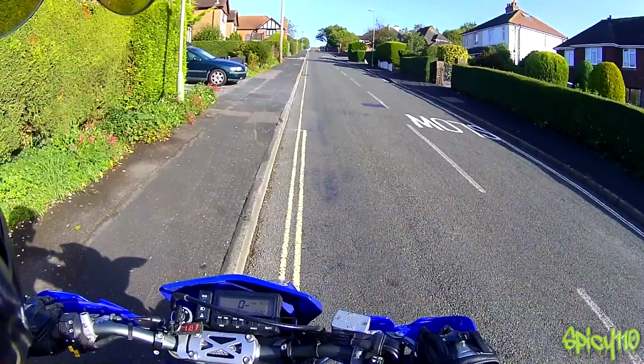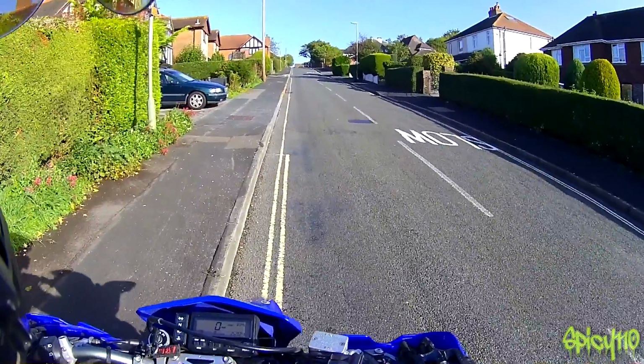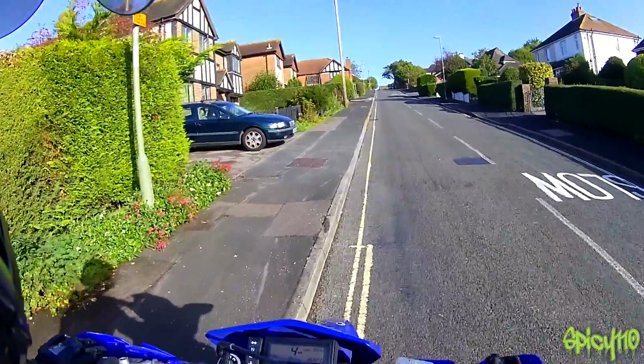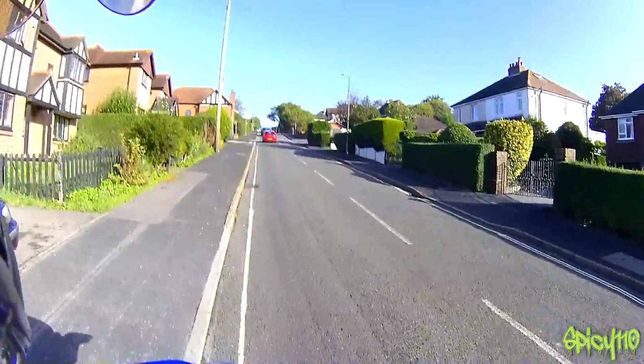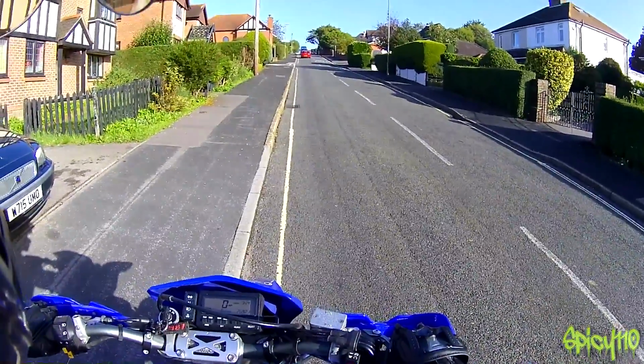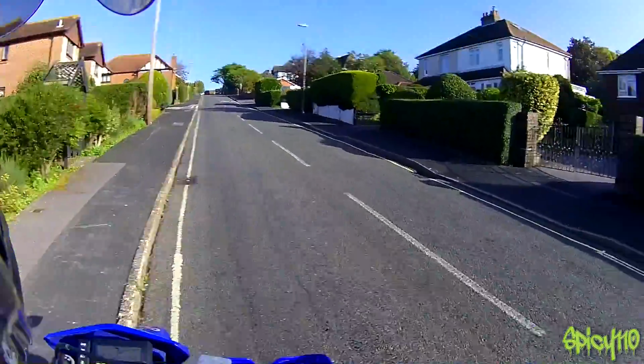So if you look, I'm going to start pulling away. Now, I've got the bike holding itself. Now I let the brake off, and you see how I start going uphill. That was using the rear brake. Again with the front brake. See, look, can you see how the bike's picked itself up? Let the brake off, and I'm moving uphill.